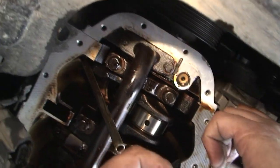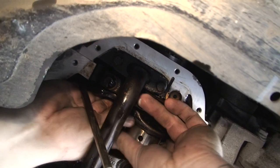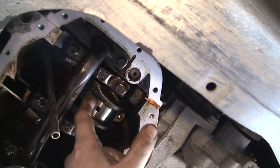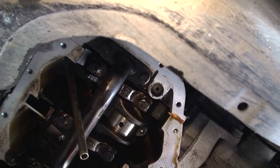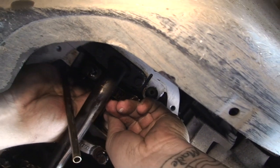Mark everything — everything is marked. I know that has to go towards the back. Make sure there's no grit in the bolts. I've got some new oil and I'm just going to spread a smear of oil on both sides — it just helps. Now this is the trickier one because we're going to have to get over the top and try and sit it down — it's possible, it's just a bit fiddly. I tend to leave it rested on the actual crank and then I'll try and bring the con rod down to meet it. I've got the con rod here now, bringing it down — it's now pushed down. You just want to make sure it's perfectly lined up — if it's a bit to one side you need to lift it slightly and just move it until it lines up perfectly.